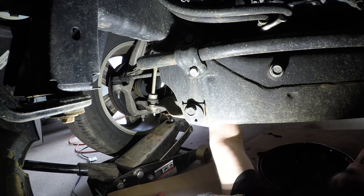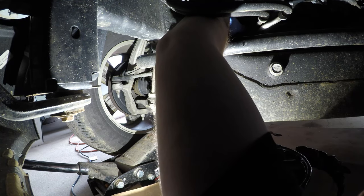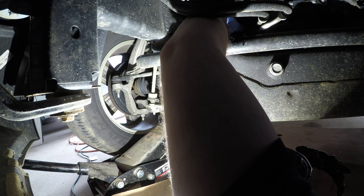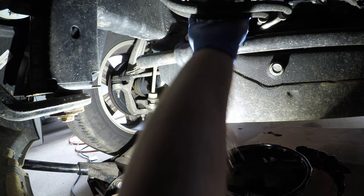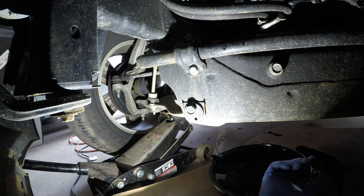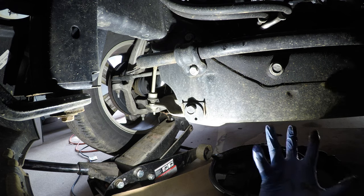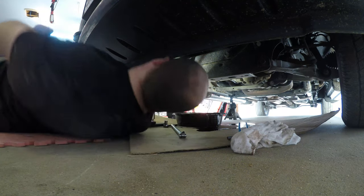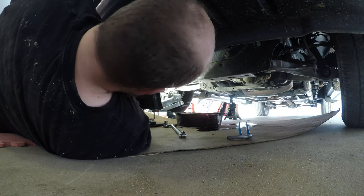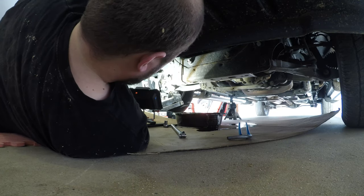This is the hardest part of this job. It is starting to drip, and if the truck has been run, the oil will be hot, so you definitely want to put some gloves on. I'll typically let it drip a little bit to get the surplus oil out of the filter before pulling it down as a unit. That's why you want gloves and a rag handy, because it's not very easy to get at. Let it drip for a few minutes — that's also why you want cardboard on your floor, because you don't want this mess everywhere.